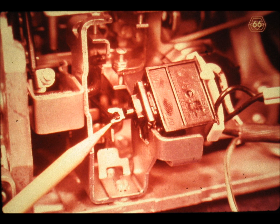If your machine has this kind of a switch arrangement, make sure that you do not force or break the indicated fork on the toggle arm when you remove your switch. At this point, you should complete the removal of the motor, the power cord, the on-off switch, as well as the ground wire from your typewriter.